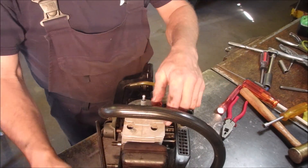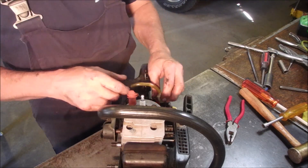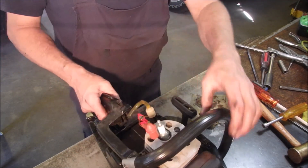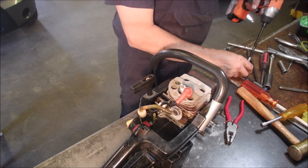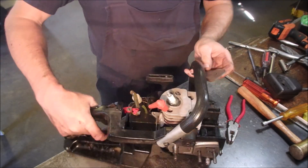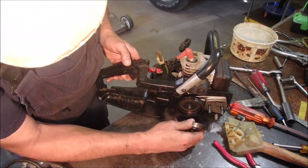This is an old saw and it's a gift for a friend. So I'm keeping the costs down and I'm not sure about changing out that crank seal. But tapping it in sealed it, and it's not rubbing up against anything. So now the last thing to clean up is this bad boy. Let's redo the muffler because I got a piece of rubber in there. I use that to plug the exhaust port and then I just hold my hand over the input port. Cool! I'm putting the clutch on and it goes on backwards - thread it backwards.